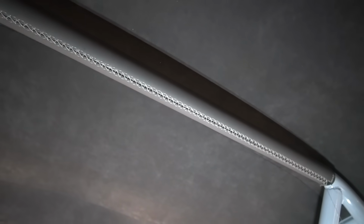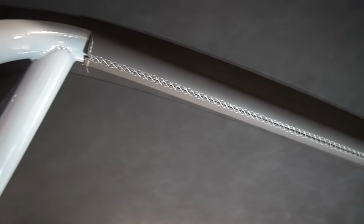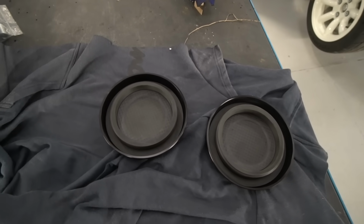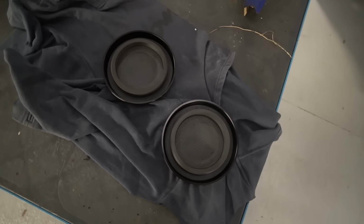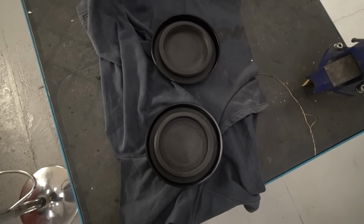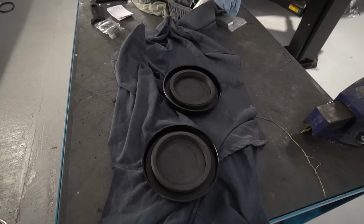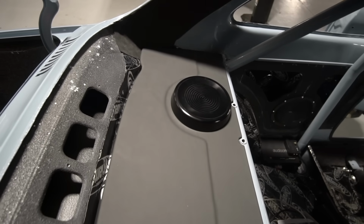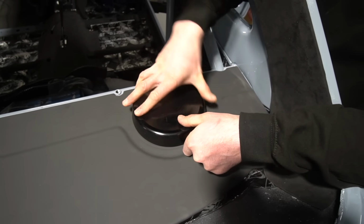As soon as Dean's finished with that cage upholstery, we will then be able to put the parcel shelf in. Gibbo this week has been trial fitting the covers we've done for the damper adjusters on the back. They're a billet machined cover, and then we've done a 3D printed section underneath that the top part is bonded to, which has a large coarse thread in it. We 3D printed them because we could latch them into place by springing them in, pushing them in, and letting them spring out again. That's the female thread, and when you screw the male thread into it, it holds it sprung out.